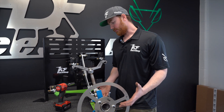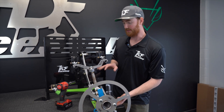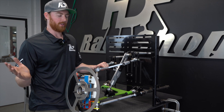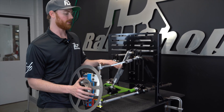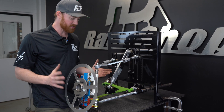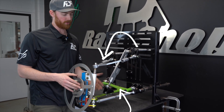For drifting, we're going to change a couple of these kinematics like the distance between the outer ball joints on the upper and the lower. We got a little carried away there on the intro, but back to the point. Let's start with what causes camber to change. First off, we're going to look at the relation between the upper control arm and the lower control arm.